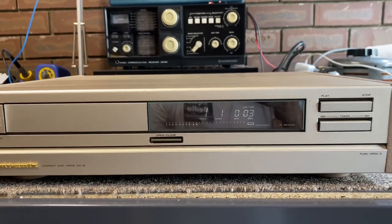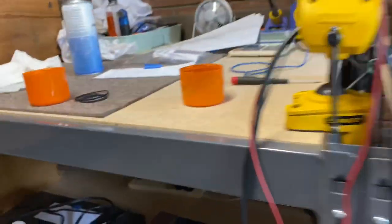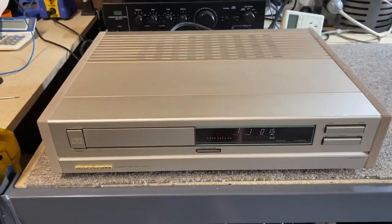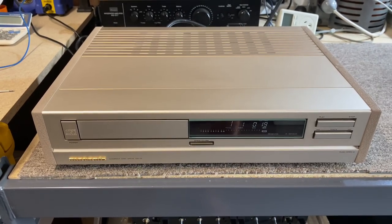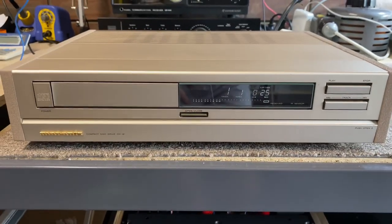This is as close to perfect as one can get — really a very good result. But it highlights the need to do more than just change these belts. Changing the belts is one thing, but that won't fix the problem. In fact, the whole tray was very stiff until I'd lubricated every roller, every pulley, all the parts of that wire drive that have to be lubed. So you've got to do those little things — when you do all those things, you get a very good result like this.